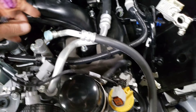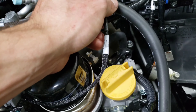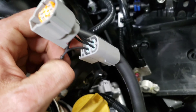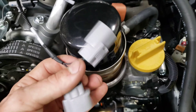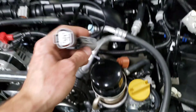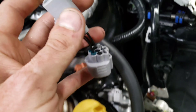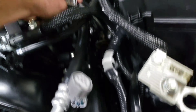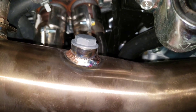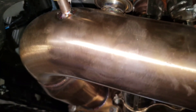All of this is labeled, which is beautiful. You're just going to fish it all down through there. This brown wire is going to connect directly to your flex fuel sensor. These are the O2 plugs — so these are going to go down. One is going to plug into your O2 sensor and the other one is going to plug into the plug that plugs into your O2 sensor. Basically it's just a T to split that up. Then these are going to plug into your TGVs, which most of us running flex fuel already have the TGV delete. So you're only going to need one of these plugs. The plug is literally right here. So you're going to need the male end — you can tape up the female end since you're not going to use it if you already did the TGV delete. That green plug right there is going to be above your downpipe, coming off this secondary O2 sensor — whether you have a stock downpipe or an aftermarket one. So these green plugs here, you're going to have to take your splash guard out to get to them.